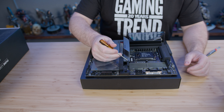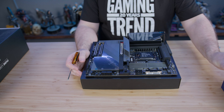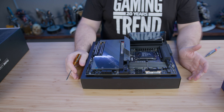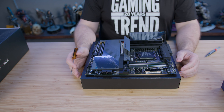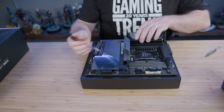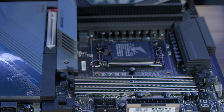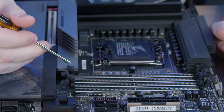This particular board is DDR5, so we have four DDR5 slots. There are DDR4 versions as well on LGA 1700 boards, but the price of DDR5 has dropped enough where there's really no reason to go backwards. Now you may see four slots and think you need four sticks of RAM — hold that thought, because that actually makes your system slower. Tighter timings and higher capacity in a kit of two is always going to be better than four. As for placement, it goes in slots A2 and B2, not the ones closest to the CPU.